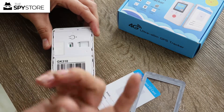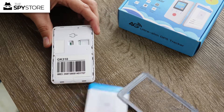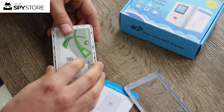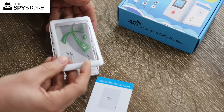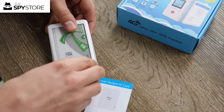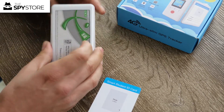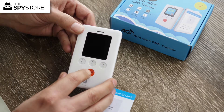Once your SIM card is inserted, you can go ahead and reinstall the ID card if you want to, or you can put the multi-rider on the back. Make sure when you reinstall the back cover that you put the little triangle cutout back on the bottom left-hand side of the unit. Push it all down so it's nice and flat, and then you're good to go. Turn the unit over and power it on by holding down the SOS button.